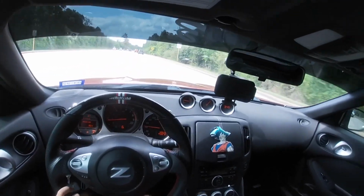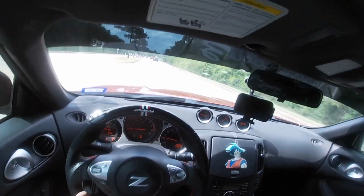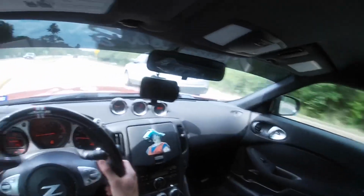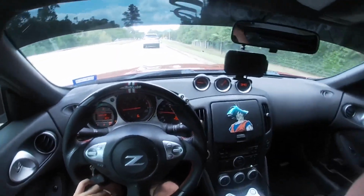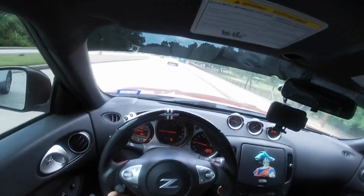Or I might have it mixed up, but I've seen people say they've put it on and then their slave cylinder still fails a couple months later. Apparently you aren't supposed to put it with the OEM clutch. You're supposed to upgrade your clutch with it too, or something like that. I would just check the forums, but I remember seeing that. So definitely get that upgrade, guys.